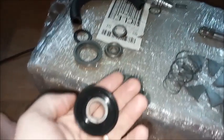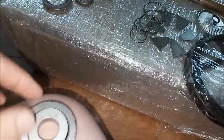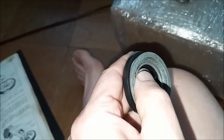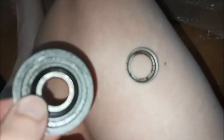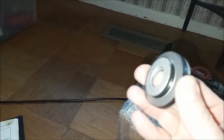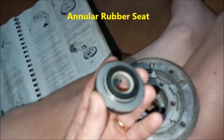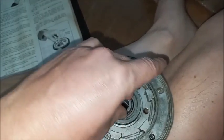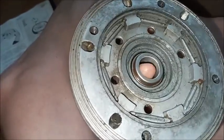And then this retainer plate sits on the back of the diaphragm, like this, with this little lip up. And then we have the retainer ring, which goes up under the lip of the diaphragm. And we have this retainer that goes on there on the floating control valve. And it operates like that. And the brakes are applied and released. I used a little brake grease to hopefully keep it in place while we just press this in. So you apply the brakes, it goes up.